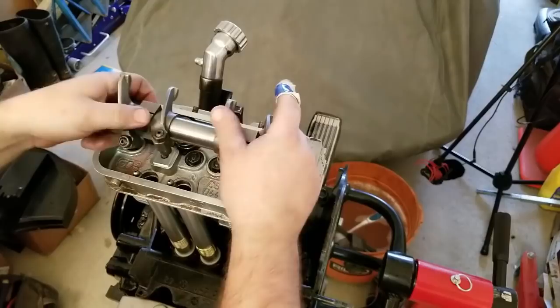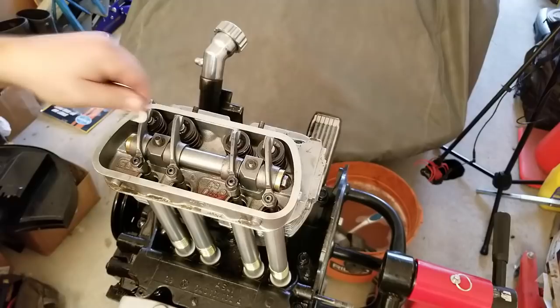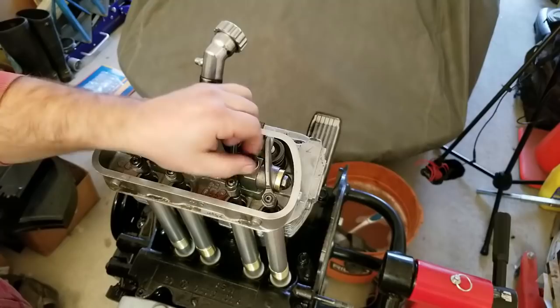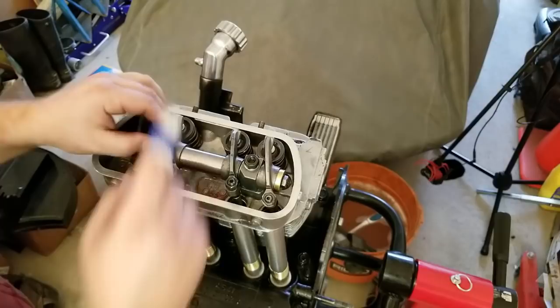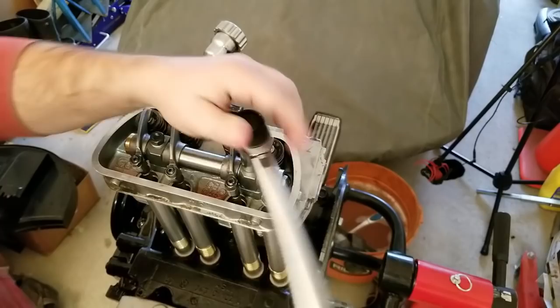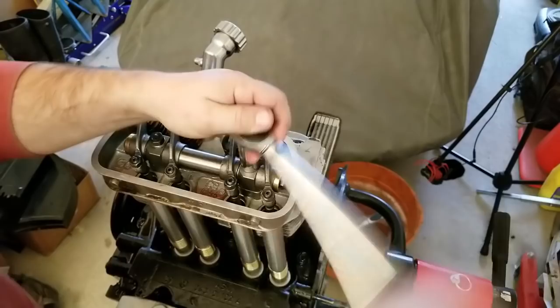Rocker is in a final adjustment. The final countdown. But I think a washer is probably better than no washer. The stock has a really thin washer on there for the rocker arms. Well, I think it's pretty thin anyway. Torque on these. What is the rocker arm torque? Rocker arm stud torque, 18 foot-pounds. Wow, that's pretty good. I could probably go 20 pounds on this with these bigger nuts here. Pro Molly hardware. I think I can get away with 20.